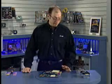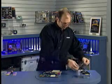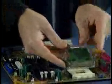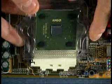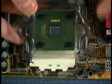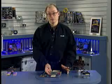The AMD Athlon is a more troublesome installation than a Pentium 4, and there are a couple of precautions to be careful about. If I show you the chip and take it out of the package, you can see that the Athlon exposes the die on top of the processor — that's the backside of the actual silicon processor die. The problem is that if you press the heat sink down at an angle, you can actually fracture the die.